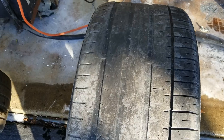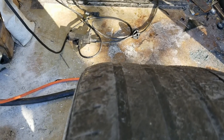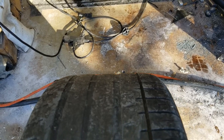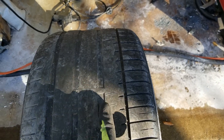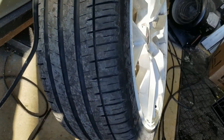Here's some quick video footage of the front and rear tires. As you can see, this is the outside of the tire and there's some decent tread depth there, but on the inside there's less. Lowering the car does put the wheels on a little bit of a camber — the alignment shop confirmed that. The outside still has some tread; if I were cornering hard a lot, the outside would have worn to compensate, but I don't do any track time.